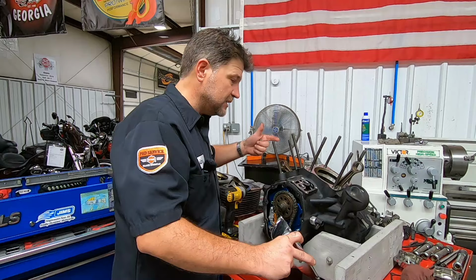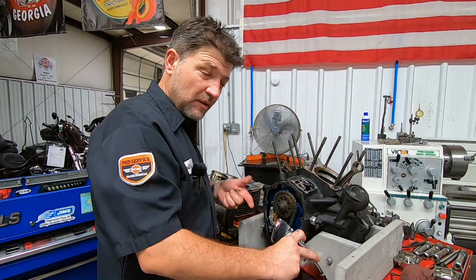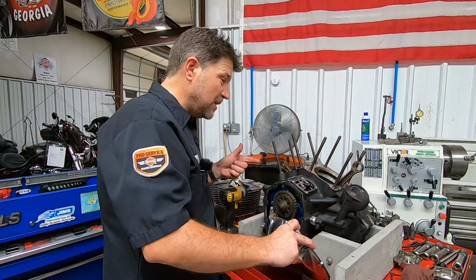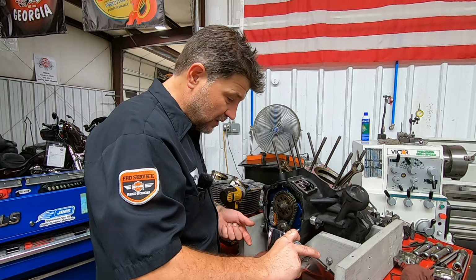Or probably about 4 ounces. If you remember a video we did where we poured the oil in and measured how many ounces it took to hit the crank, there's probably about 5 or just a little over total in the bottom. So you'd have about 4 ounces in that sump, and then maybe another ounce or so, just enough to tap the crank. So it really didn't appear to be something that bad. This little amount of oil here is not really uncommon. See any trash in there?